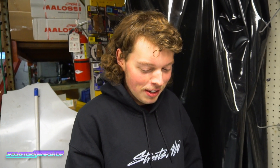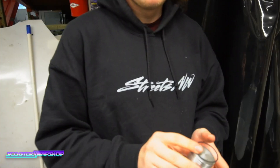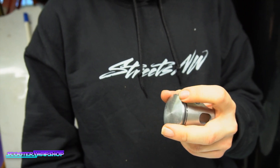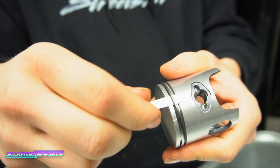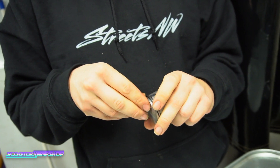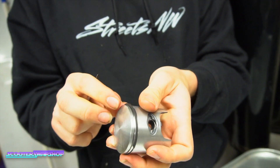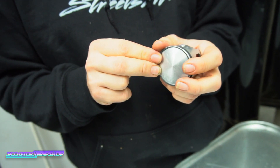Tech tip of the day — we're going to put piston rings on without breaking them. Sometimes they're really tight. So you get it on there. Sometimes they can get stuck. You take your feeler gauge and stick it in there, get her in the groove. Use a wider one — a wider one may work better. Then you work it around to the edge and they just pop right in. You can see if you're on the top one — this works, sometimes it's more needed than others. These top ones are a little bit harder — they're chrome ones.